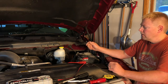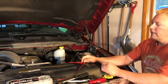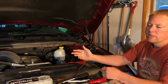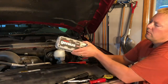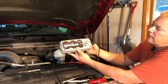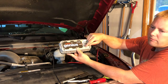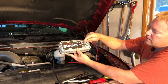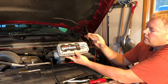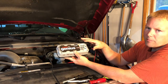What we're going to do before we remove the battery or undo the terminals is get a power supply of somewhere between 12 to 13.5 volts. I have this NOCO Genius charger right here — the G7200. The nice thing about it is it has a supply voltage mode at 13.6 volts and a max of 5 amps output. By putting it in supply mode, not charge mode, it's acting kind of like a separate battery.